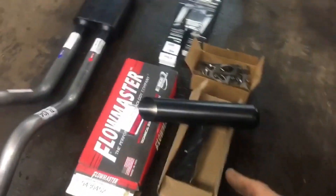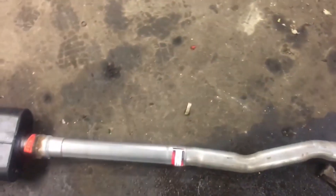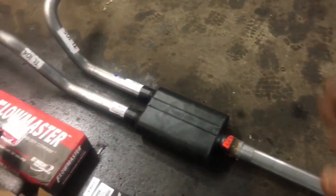On ours, we're actually going to cut it and angle it off so it looks a little bit cooler than just straight pipes coming out the back. These tips have to be welded on if you're buying this kit from eBay, but the kit is numbered — pretty simple installation. We ended up buying a couple extra pieces, and this is an original factory piece that we took off of the original exhaust system. So we'll weld all that together and put it up inside there.